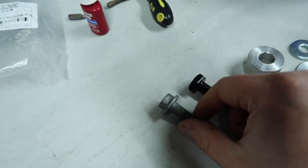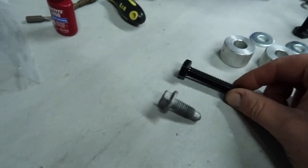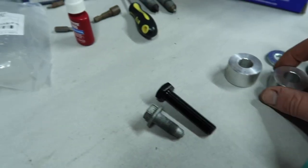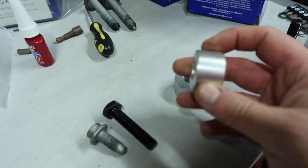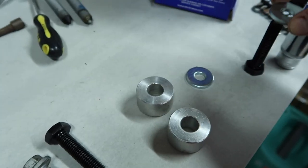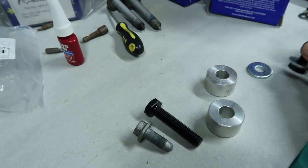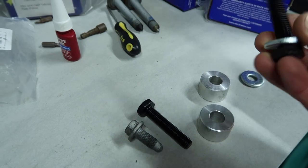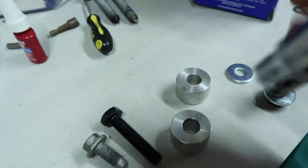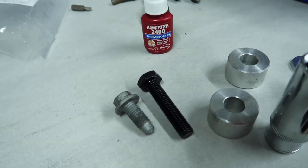Out of the car, I'm going to do another side-by-side comparison. This is one of the bolts we just removed, and this is one of our new replacement Summit bolts. You can see the length difference, which is accounting for our new brace. We also required the use of these spacers, which are provided — they feel like aluminium. Then we also have washers, which will go over that. So we're going to go spacer, then brace, then washer and bolt up through, and then get those tightened up on either side. They require a 17mm deep socket, and like before I'm going to use some Threadlocker Blue so that they don't loosen under vibration.